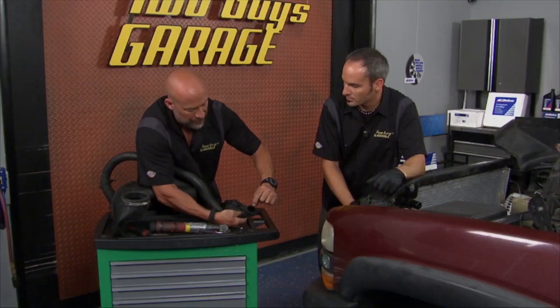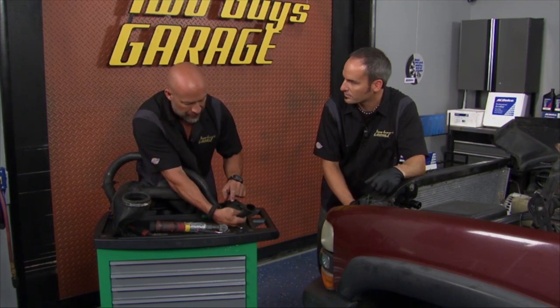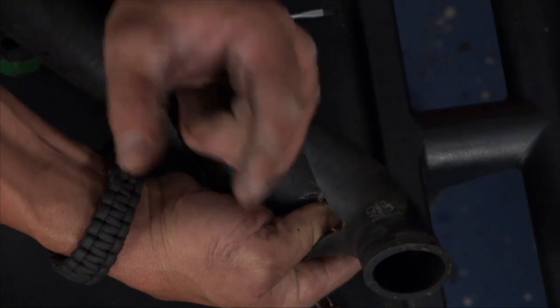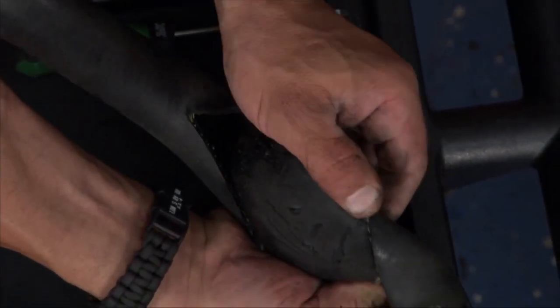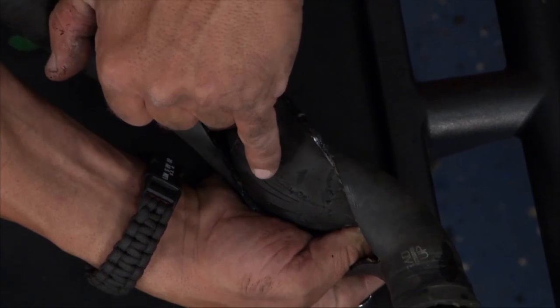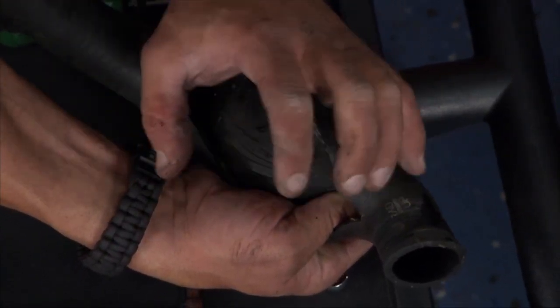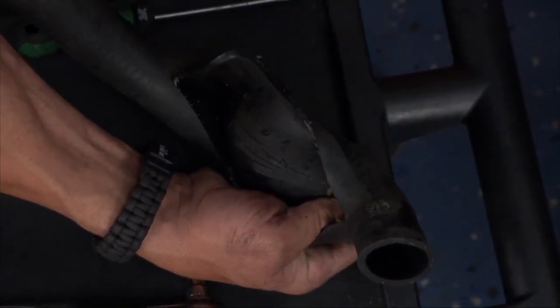As soon as I saw that these threads were wet, I said, okay, it's probably wicking through this rubber into this nylon, into this string right here. That's a real good indication that you have problems. And sure enough, if you could see that, all these fractures, all these cracks, even these lines here, what's happening is that coolant is wicking through here, soaking that nylon, and it's making this hose act like a big, giant wire. It's crazy.